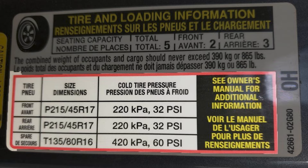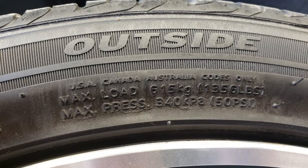On this sticker, we will find the factory recommended tire size and tire pressure for the front, rear, and spare tire if equipped. Note that you should never use the maximum tire pressure on the sidewall of the tire itself — this is the maximum tire pressure for setting the bead and not a recommended tire pressure for the vehicle's operation.